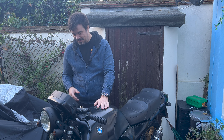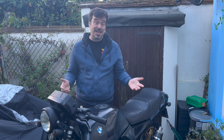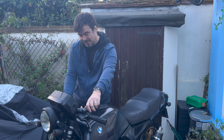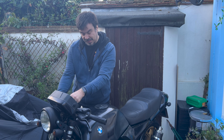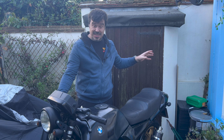My focus really should be on getting it started, but while those things are waiting to turn up I've been shopping — I've got a new fuel cap coming and I'm going to bleed the front brakes. Hopefully that gives you an update of where I am. I'm going to give this one last go so you can hear exactly how it's almost starting, because it makes me excited. And that's the bang — it doesn't do that very often, which means a lot of unburnt fuel is getting through.